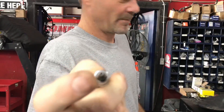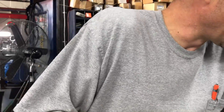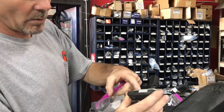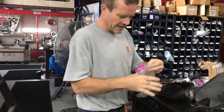Torx 20 with a hole in the middle — go ahead and take this off. Be careful when you pull it out, it's got to twist a little and there's a little o-ring down there. If we don't have issues, don't even clean it — put it in a bag and it'll go right back in the truck. Wipe around the o-ring but be careful because it heats that element up.